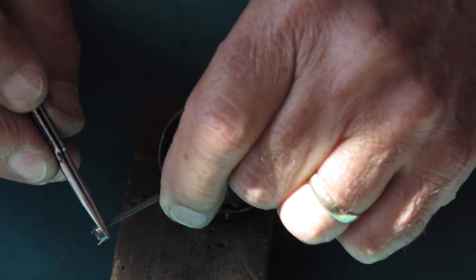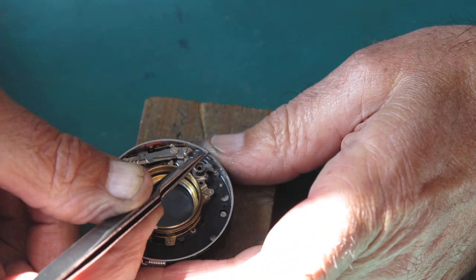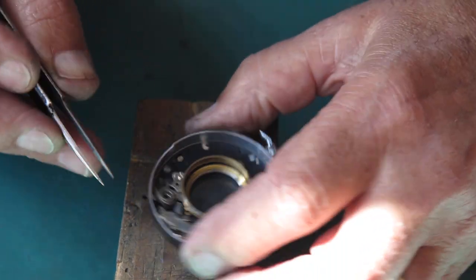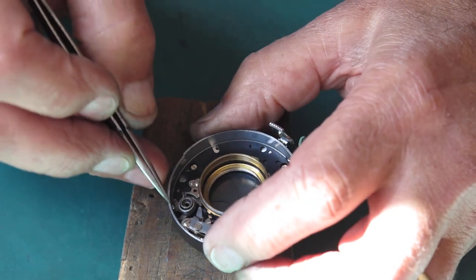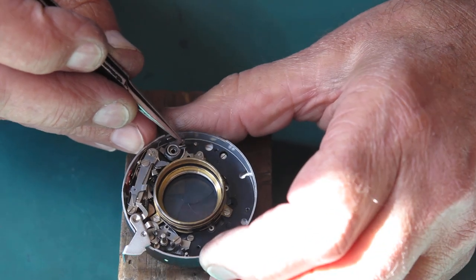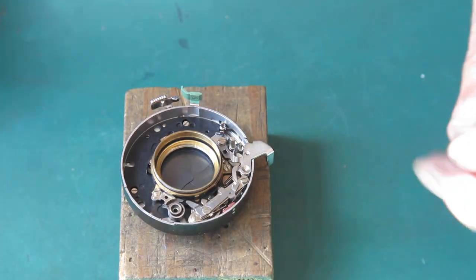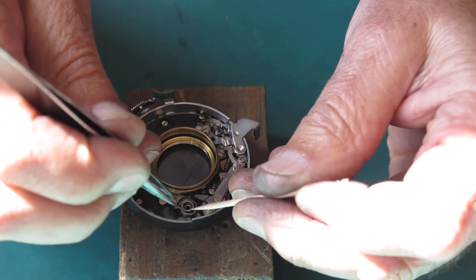A wipe of molybdenum paste to the inside of that — it would have been lubricated originally with graphite grease, which is a good thing. Now the tab drops into a little hole on the arm, and I've got to take this tab here and swing it right round and hook it behind there, which is one of those jobs you probably can't see me do because my fingers will be in the way.